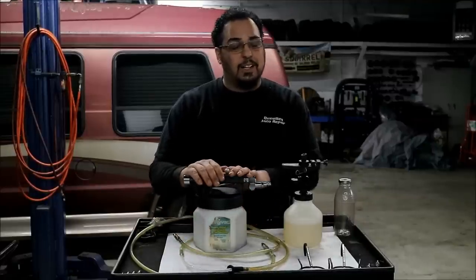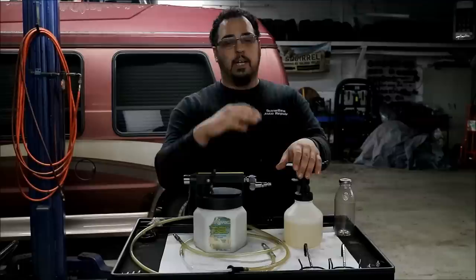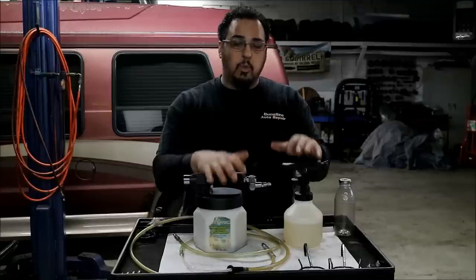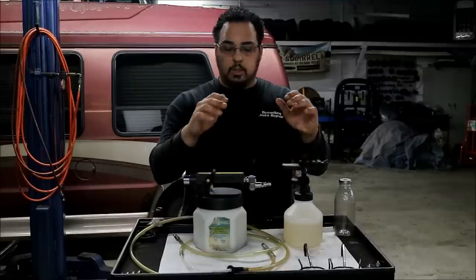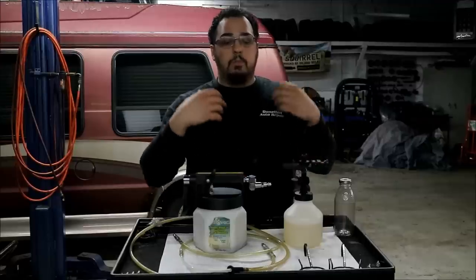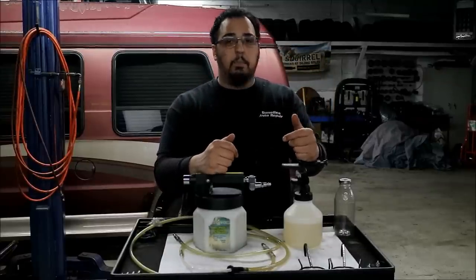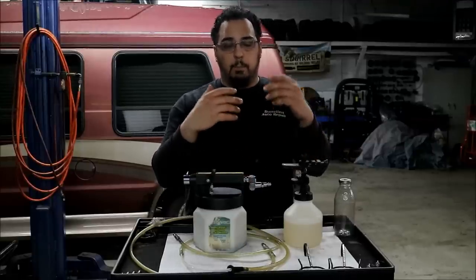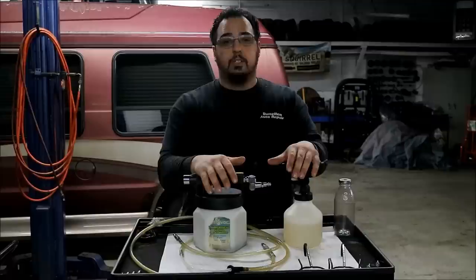This tool looks a little beat up and tagged, but I use it a whole bunch. I do a lot of brake flushes — I try to sell brake flush services on my brake jobs and sometimes with oil changes too. This tool makes the job much easier and quicker. I have a lot of Mighty Vac tools that work great for me, so why not spread the word? Definitely use this tool to help bleed the brakes, but also pump the brakes manually afterward to make sure all the air is out.